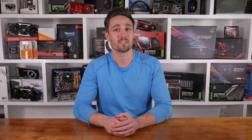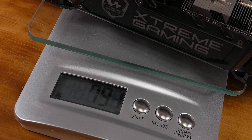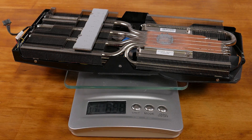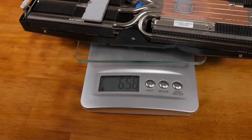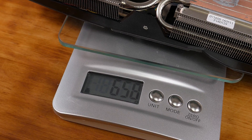Airflow is just part of the equation — you have to extract the heat first, and doing just that are two very large heatsinks. The Xtreme Gaming uses what looks and feels like a much larger cooler, weighing 791g, meaning the cooler makes up almost 70% of the card's total weight. This also means it weighs 20% more than the cooler found on the ASUS Strix card, which is pretty shocking. The Strix cooler weighs 658g, which is a little over 60% of the card's total weight. So you're definitely getting much more metal for your money with the Xtreme Gaming, which can be seen as both a positive and a negative depending on your point of view.